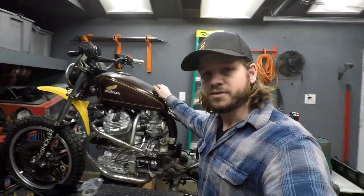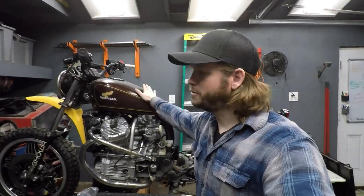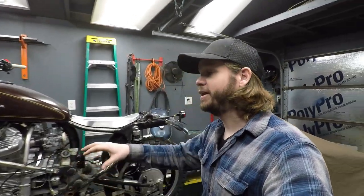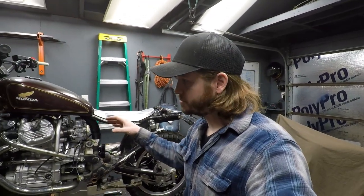With this custom, you have 3.3 gallons on this tank. If you look up the specs, you'll see anywhere from about 40 miles per gallon up to 50 or maybe 55 on the highway, but I want to use 45 miles per gallon as an average. It might not be going down the highway as much as it will on gravel roads. Doing the math: 3.3 gallons at 45 mpg gives us about 148.5 miles of range — let's round that to 150. If we add a gallon, 4.3 gallons at the same rate gets us to about 193.5 miles — you could stretch that to 200.